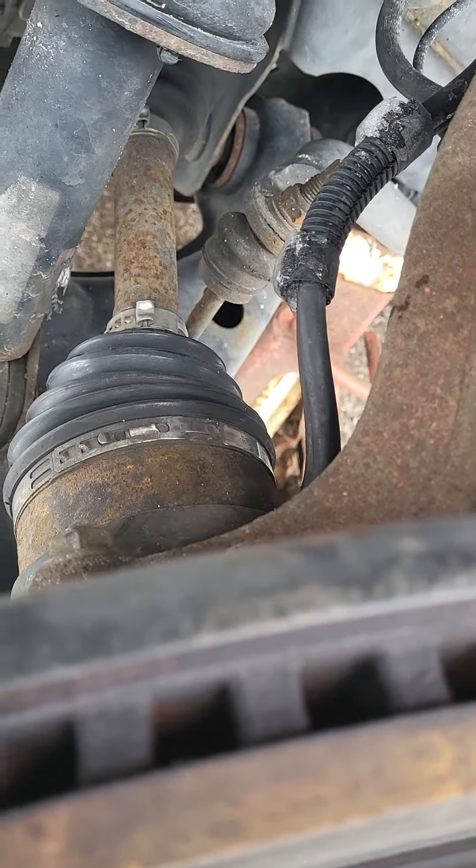You'll feel vacuum here. The vacuum pulls the hub in for two-wheel drive, so it's not engaged. If you pull this hose off, four-wheel drive will engage. In two-wheel drive it'll turn without the axle. So I think my hubs are bad — that makes the most sense at this point.